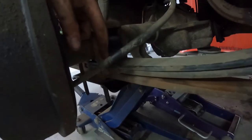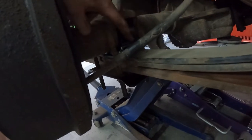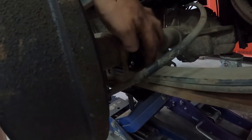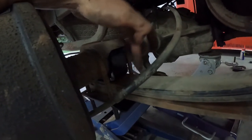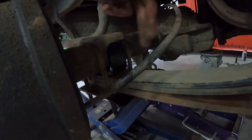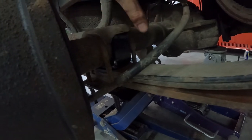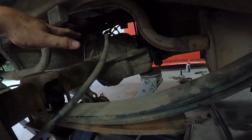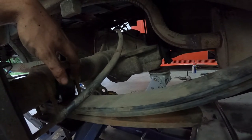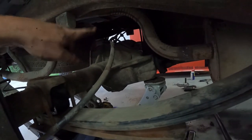We got everything buttoned up here. Got the new lower plate, got our pin flipped, new lower plate, stock U-bolts back in. This alignment bracket sits up in the saddle here and sits on the alignment pin and the leaf spring. There's a hole here that's offset — you want your hole towards the front. That's just going to account for the driveshaft. Without further ado, we're going to throw the shocks in there and I think we should be done with the back.